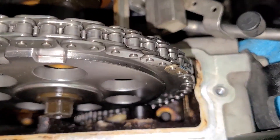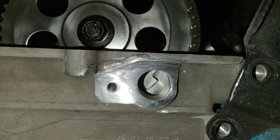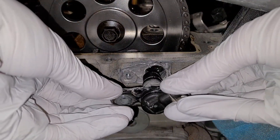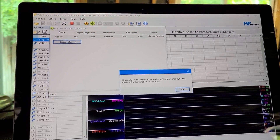With the sensor in much closer proximity to what the factory setup is, I sanded down the mounting surface to properly adjust the air gap, which was previously a quarter inch and needed to be 45 thousandths of an inch. With everything cleaned up, I used some gray RTV to remount the sensor and seal it in place, then did a crank variation relearn using my scan tool.